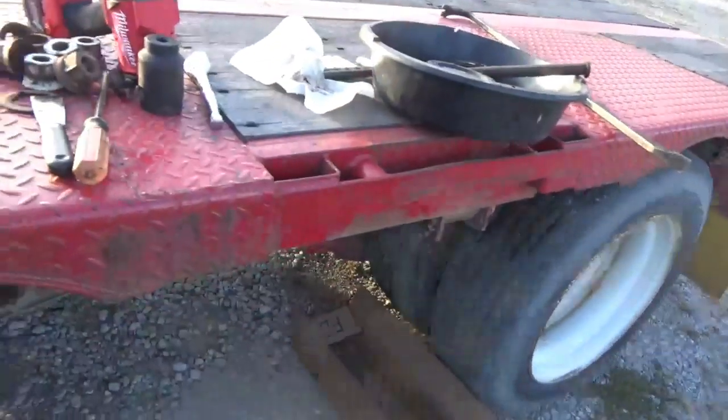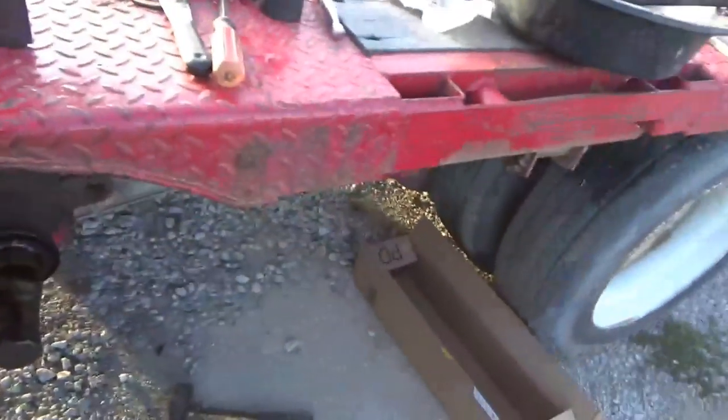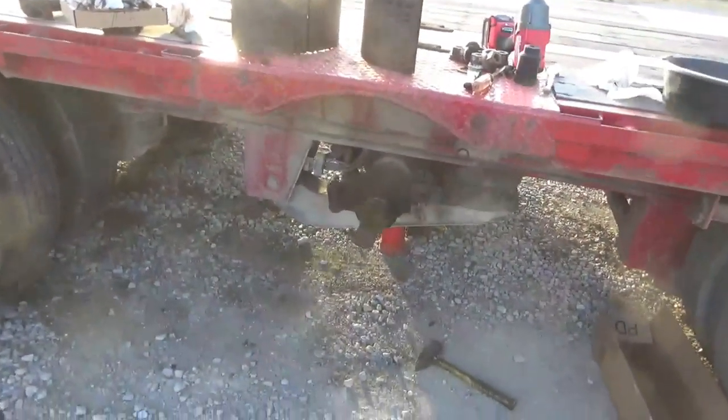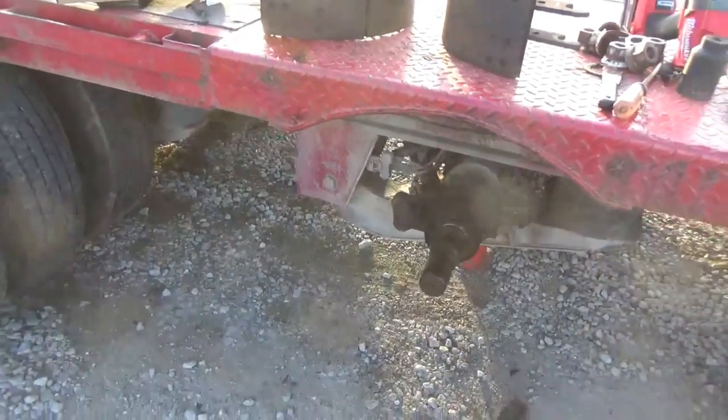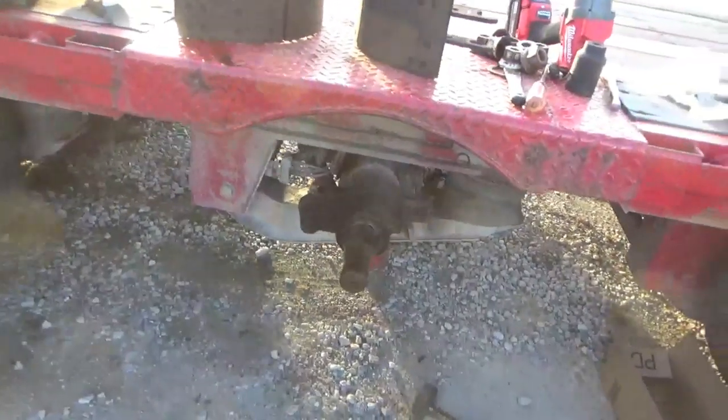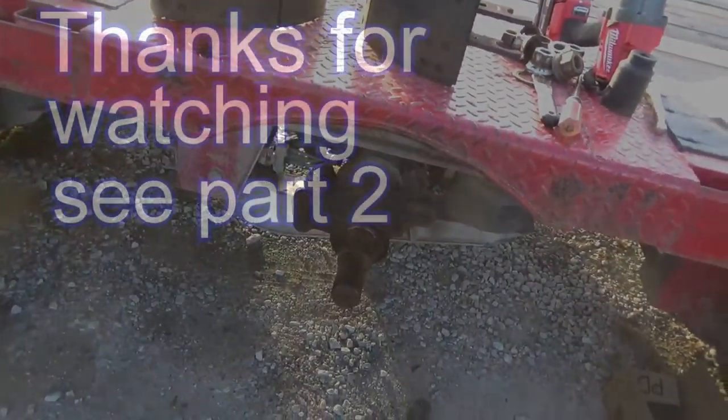Here's a good reason why you only go down to a quarter inch of padding on your brake shoes — look, we're already into the metal rivets. That'll be it for this part of the video. It'll be a few days before I can do anything else. I could go to the other side and take that off, but I'm going to get the parts first. Wasn't that big of a job to take it off.